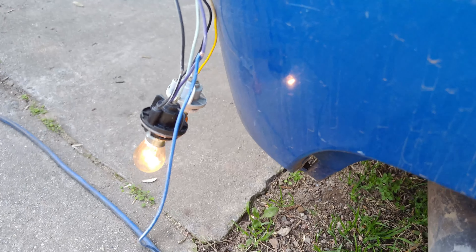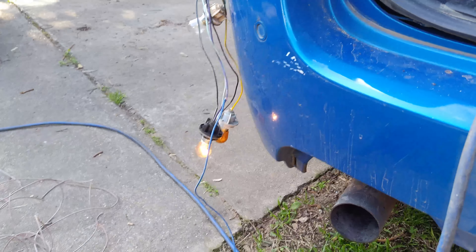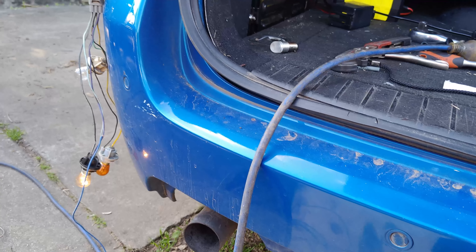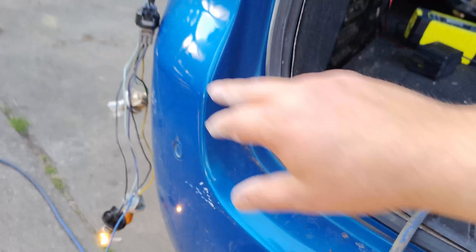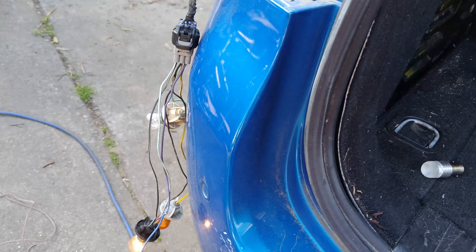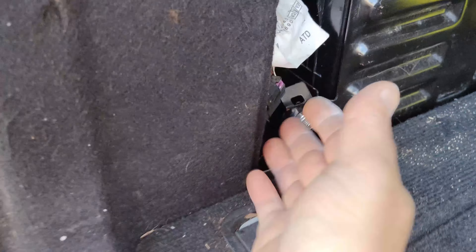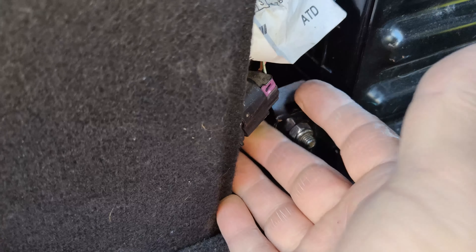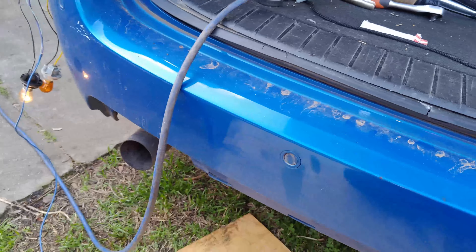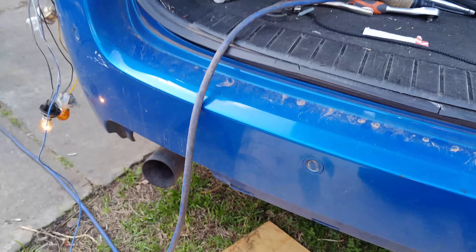There you go — a simple test: just running a wire from the parker light underneath there to there and I can get the parker on that side working again. I don't know why it's failed yet. I've also taken this connection apart, put WD-40 in there, put it back together, made sure everything's right. It doesn't show any problems and it doesn't look like there's been any tampering — on the inside connection either. So I don't know why that side's not working, but running a wire across fixes the problem. It's just a workaround.